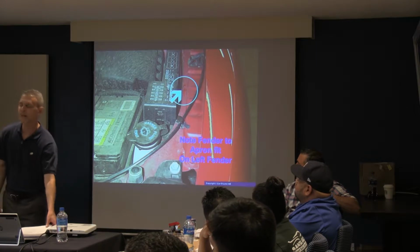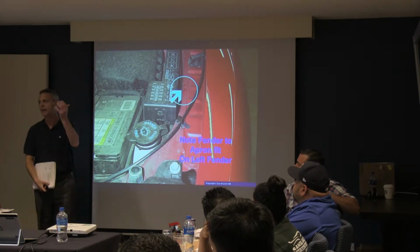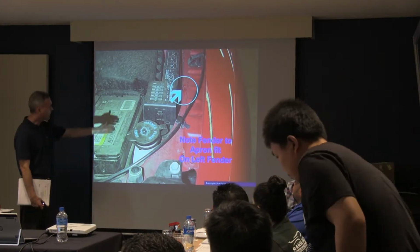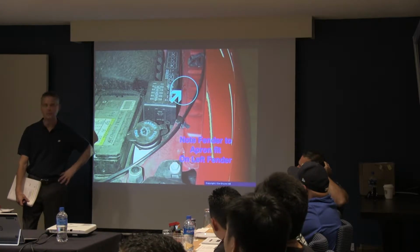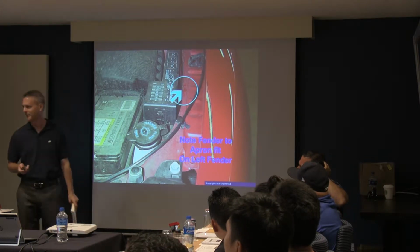My point again, I know we're not fixing any of these, is that if you just pop the hood and you don't use any kind of system to go look up the data, or you don't measure with a system and you just pop the hood, most technicians are going to say, man, something's bent. We're swung over. We're going to have to set it up and pull this thing back. You'll be pulling a car that's actually not bent.